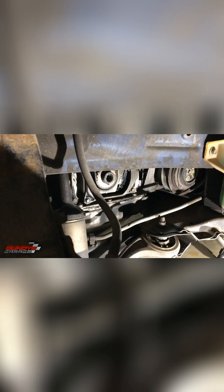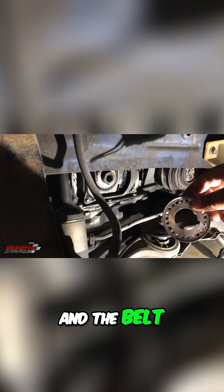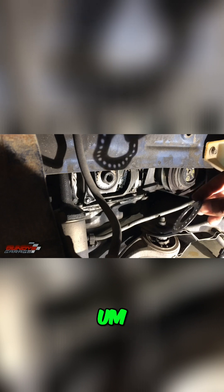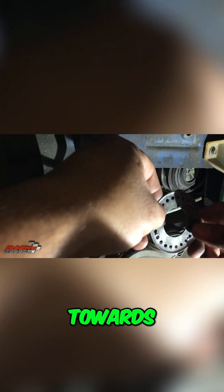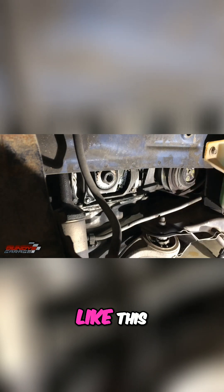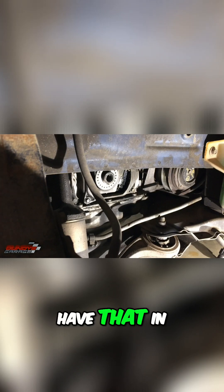Okay, so this is the piece I'm talking about — it's like a beveled washer. This should have been on the crankshaft between the crankshaft and the belt. It's kind of hard to see once you get in there, but you'll see that it's beveled. It's beveled out this way. The beveled part should be towards the crankshaft pulley. It would sit in there just like that. Make sure you have that in place.